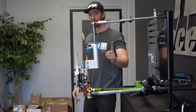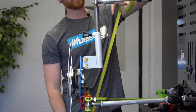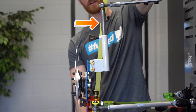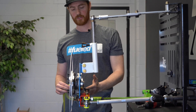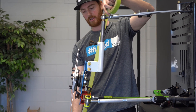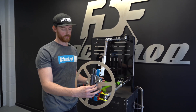If I just draw a straight line using the front edge of the tape, you can see it needs to pass through the upper and the lower ball joint. Right now I'm running a relatively low KPI angle — you can see by following the edge of the tape that this is how that line looks. When we do changes by lengthening the control arm, you can easily see that if I pass this through, the KPI angle has already increased. So this is going to be the difference between the two setups when we measure our static camber angle and then measure at full lock.